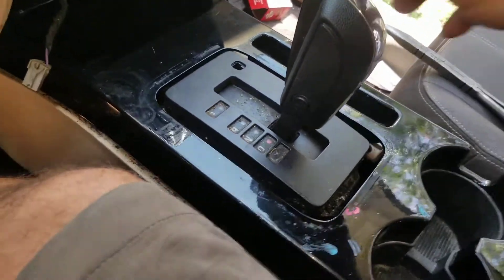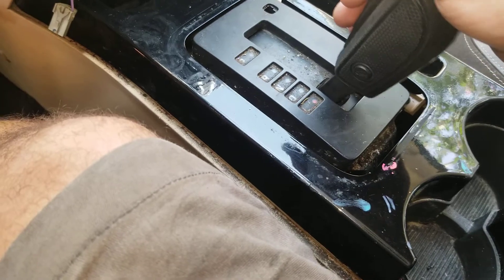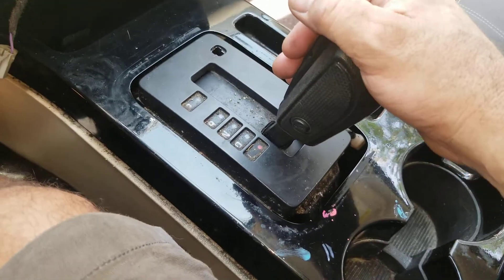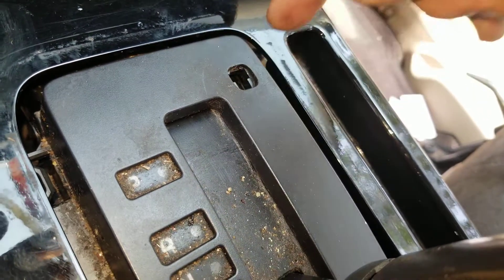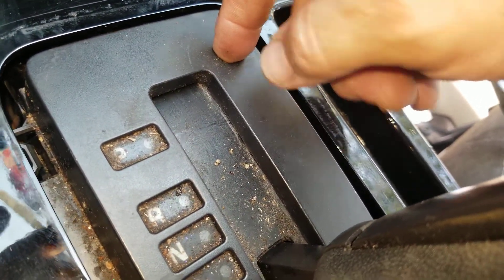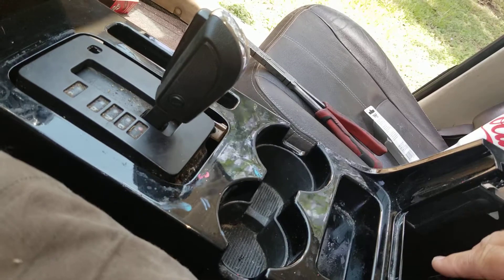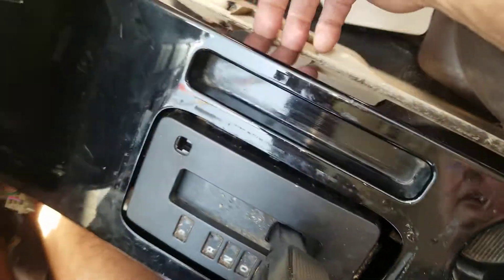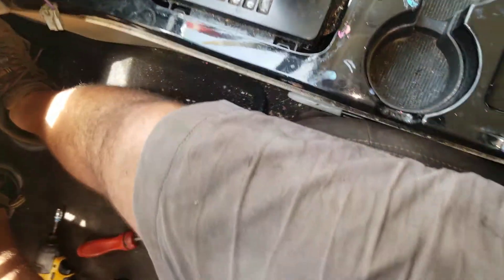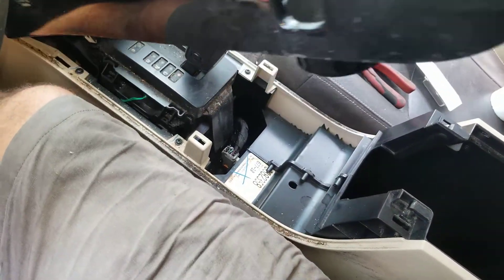Your gear shift won't be working properly, but you'll have to get this gear shift into a lower gear. If you don't have the battery connected — which I recommend — you can pop this little pilot hole out with a knife or something, and poke your screwdriver or key in there, and that makes it so you can shift when you don't have any power. This whole thing comes up like this, and it is a bear. You'll have to go all the way around and slowly pry all these edges up — real slow — because it's tight and it doesn't want to come out.